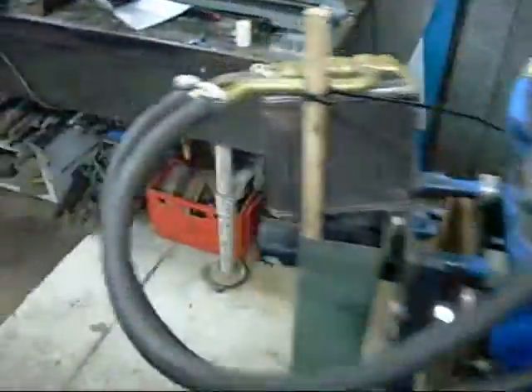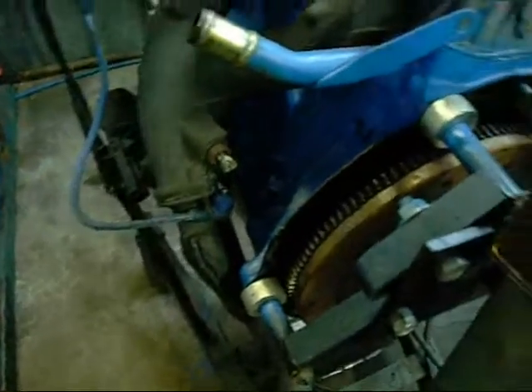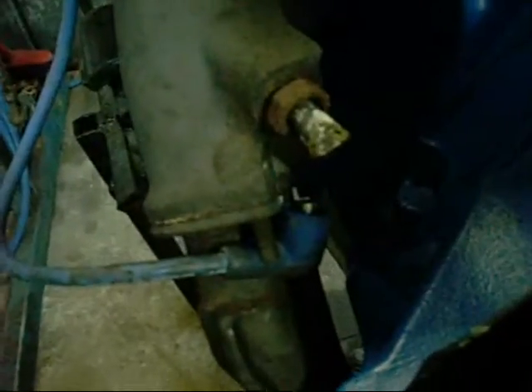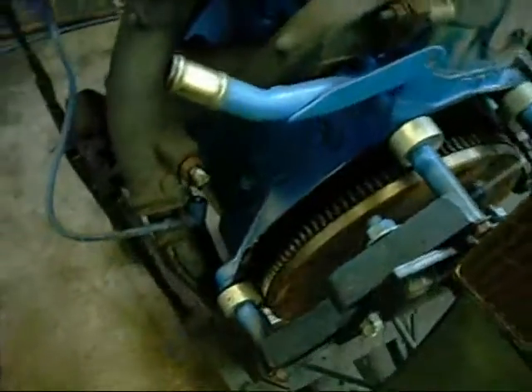You could try and drive it through the cam chain — or the cam retainer nut — but if you loosen that thing off then you could end up in a world of trouble. The camshaft won't go anywhere, you just have to make sure you put it back on tight. Easiest thing to do: you don't have to take the dizzy cap off like I have, but just take your coil lead off, put it somewhere where it can arc out, and just tap the key until you get it in the right position. In this case it's easy because I've got a remote controller. I don't know where that coil is shorted out, but then again I've got the ignition turned off — so that's just another one of my little hot-wire things. In a car just make sure it's somewhere it can arc out to ground.